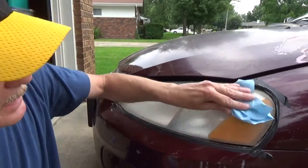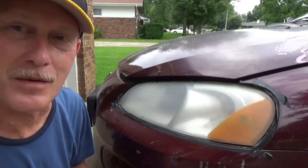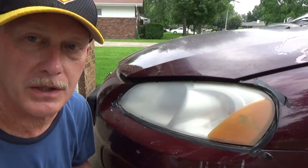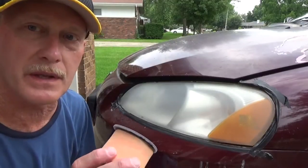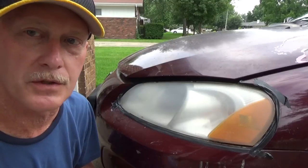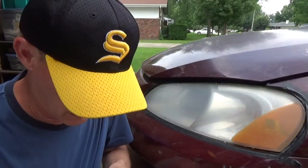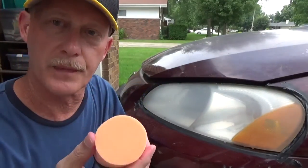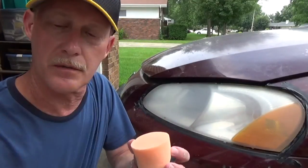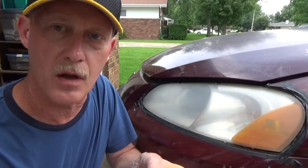That's to be expected. Now we use a 3000 grit sandpaper and go over that same process again before we use, I think, the actual polishing compound, but we have to do the 3000 grit and get it a lot finer and get all the really minute scratches out. Now I've finished using the sanding pads, so I take that off, and you're going to turn it over and use this side and use a quarter sized spot of the rubbing compound and finish clearing all the little fine scratches off of the lens.